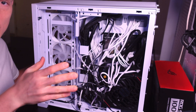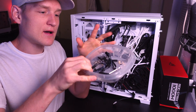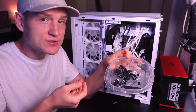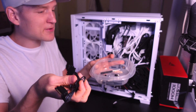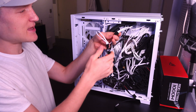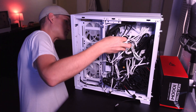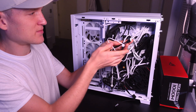All these cables that you're seeing — the white ones — it does not matter what order you plug everything into. All these extra wires that Lian Li includes for their AIO, you can absolutely use them, but they're unnecessary and make it very confusing. Basically, the main thing you have is this little hub right here, and this is powering all of the fans. I'm going to show you how you connect it to the motherboard.